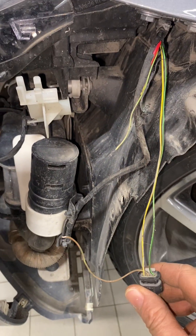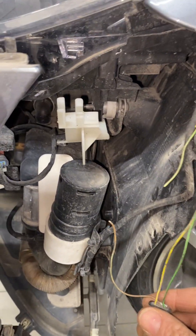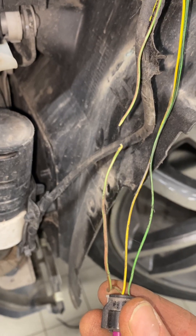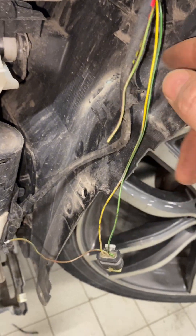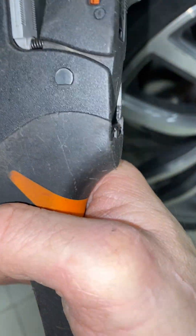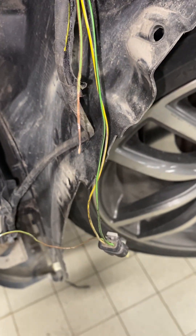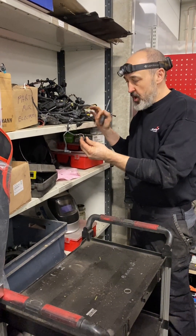The wiring for this one actually goes into the car in a quite unusual direction, so I'm glad I pulled the bumper up to get to it. In the past, someone - you can't quite see it - but they've pinched that wire and trapped it when they put the bumper on, possibly even from the factory. It's been rubbing and that's the good thing - we can find it. What we can do now is bare this back and see what condition the wiring is in. We've got lovely clean metal so we can repair it right there.